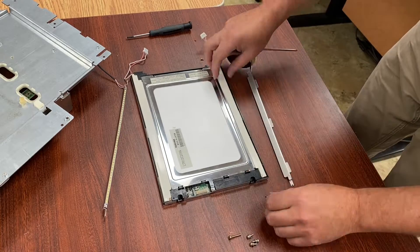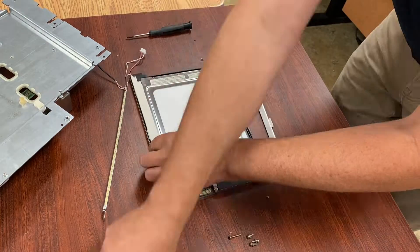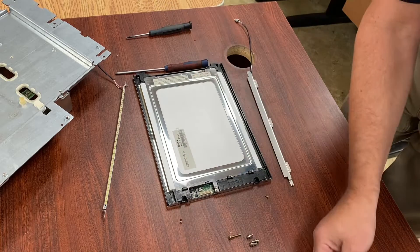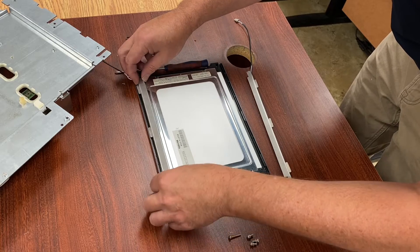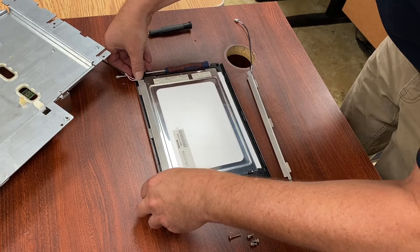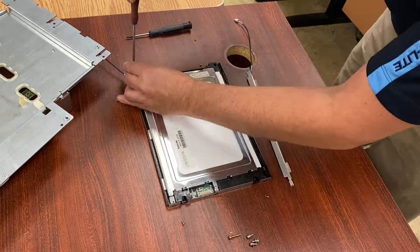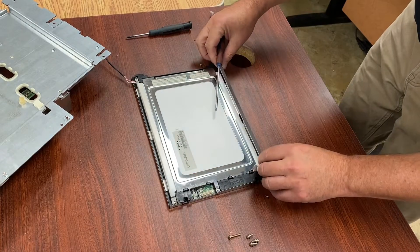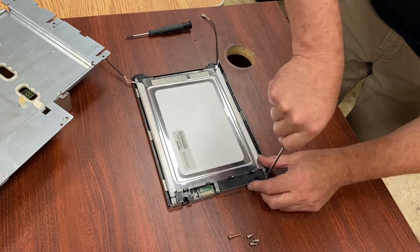The LED strip has a special case on it so it mounts right in there with very little difficulty. It's just two screws that hold it down — they're kind of small screws, and you reuse those screws so don't throw them away. With the Monotech strip, there are three clips along the edges. You push those in first and then it snaps right into place. There's a left and a right, so make sure the tail is coming out the correct side of the LCD panel — the same way that the original wires are coming out. Then there are the two screws and we're done.